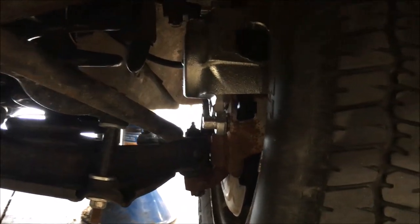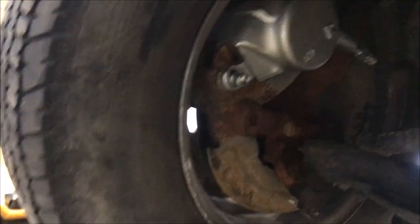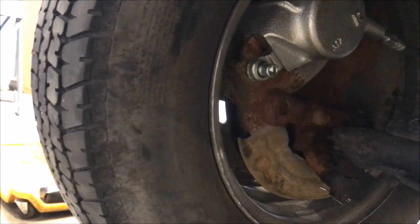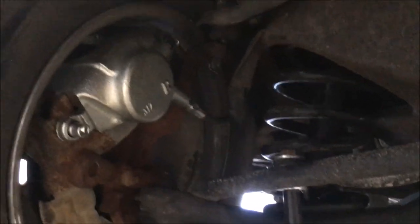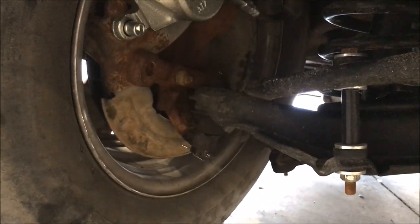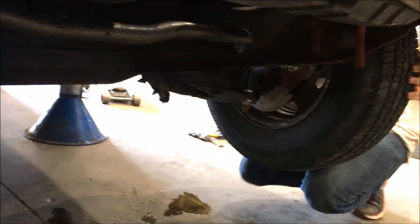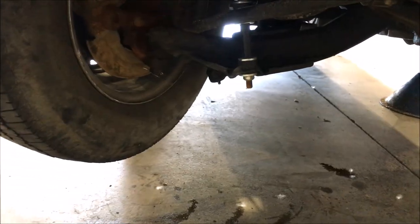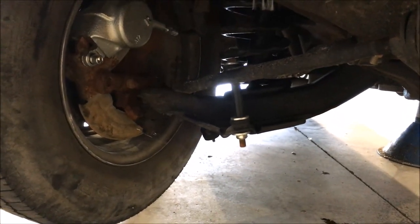The spindles are on. One nut on the tie rod for the driver's side stripped out, but besides that all went well. I've got 15-inch wheels — that was standard in 1970 — and we just barely have enough clearance. I popped off the upper and lower ball joints, the tie rod, took off the brake line, and everything went right back into place. I used a jack under the lower control arm for the lower ball joint. Going to drop the car back down, change the master cylinder, plumb a few lines, and hopefully it'll only be one more trip to the parts store.